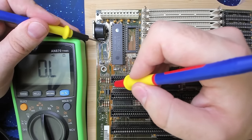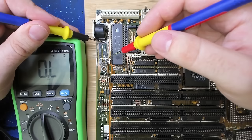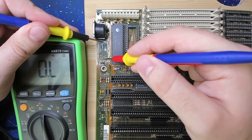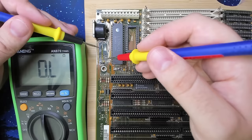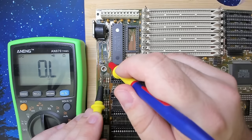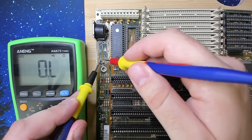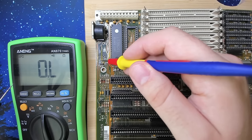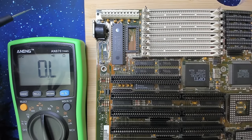It probably goes through these resistors and diodes somewhere. I think this is what I would prefer — going backwards, we should end up at the power connector. So first this is the trace that we repaired. I put a wire in here and it goes to a pin header. These two on the right are ground, and the next one here is our plus terminal from the battery. Next to it is the external battery connector, so I assume that's the positive terminal of the external battery that goes through the circuit here and powers the BIOS chip without being charged by the circuit.